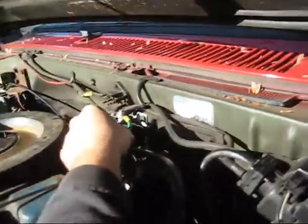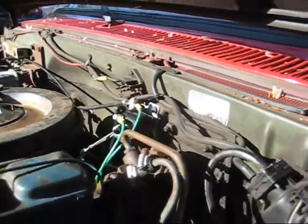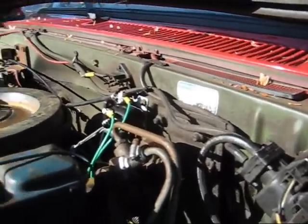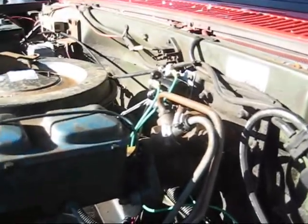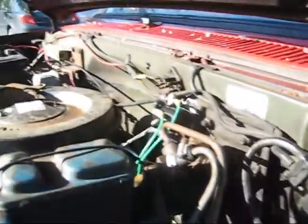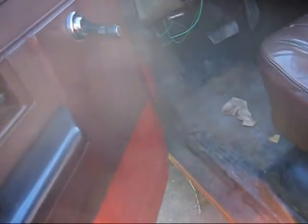You see this big plug thing? From the other side of the power terminal, I took this green wire here and ran it to a push-button switch inside the truck. The other side of the switch has a line which goes to the switch, which activates the solenoid and turns the glow plugs on. There's my push-button. I went through like 16,000 different sets of plugs because the guy who owned the truck butchered the wiring like you wouldn't believe.